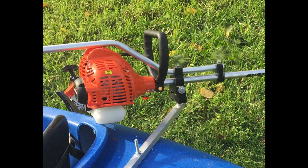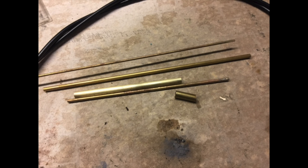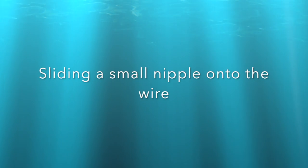I'm going to show you my trick for adding or replacing the nipples on brake and throttle cables using some brass tube from K&S metals, but you could get them anywhere. You need to measure the diameter of the original nipples and find some brass or copper tubing with a similar diameter. I'm using 3/32 inch and 5mm tubing in these examples. So let's see how it's done.